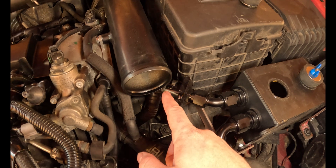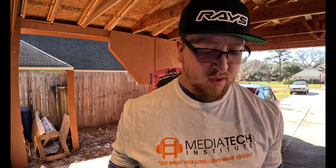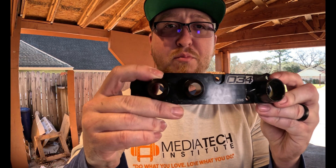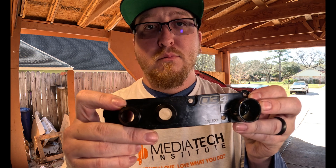This was actually the trickiest part of the entire setup — going from a one-inch hose down to a dash-10. There were no fittings like that I could find, but I did find another solution. Normally this is a plate that comes by itself to replace the PCV valve entirely, so you have two dash-10s coming off the head and then the big one-inch coming up from the lower crankcase assembly on the block. I looked high and low for a one-inch barb down to a dash-10 and could not find any such fitting, so here's exactly what I did — I chopped it off, because it has the one-inch, and I actually tapped the inside of it with I believe an M14 or M16 by 1.5.